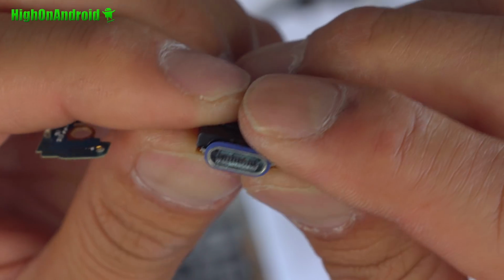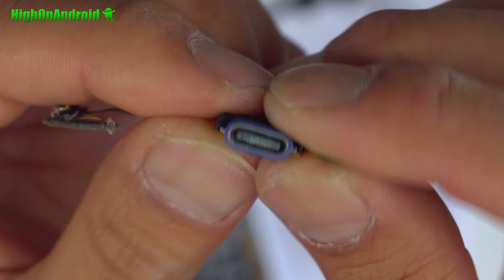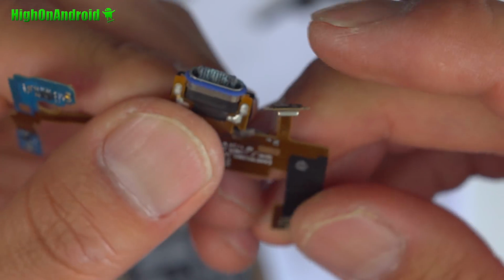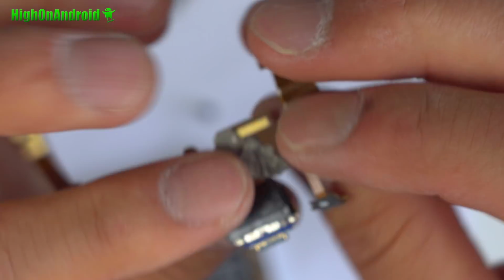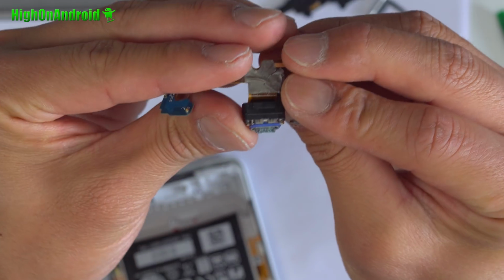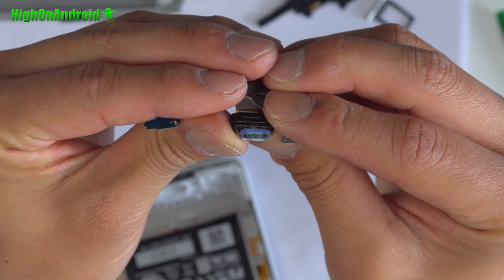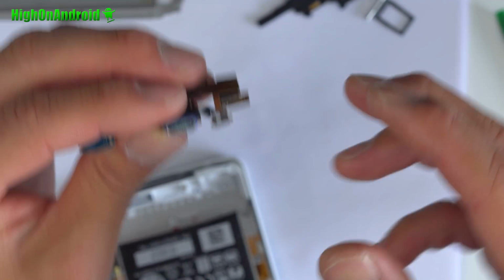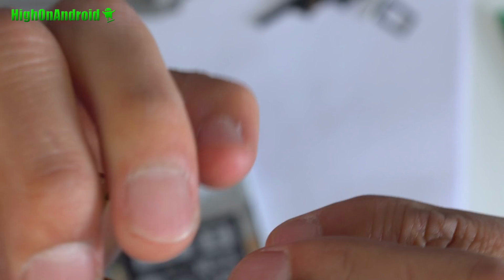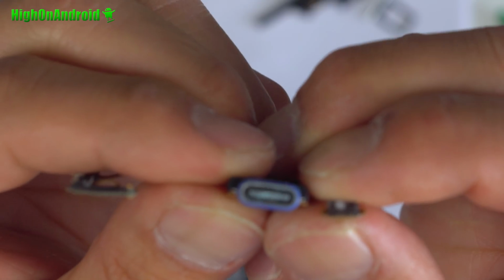It seems that even after I rinsed the phone, some of the salt droplets remained in the phone's USB port, and when they dried, it corroded the USB metal connections. I think if I had used a toothbrush to rinse it off and make sure the USB port was free of salt water, I would have been just fine. Now, this is probably easily fixable with a USB module replacement, which I already ordered on eBay for $40, and I'll give you an update once I fix it.